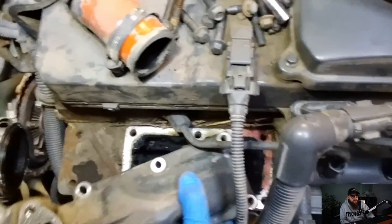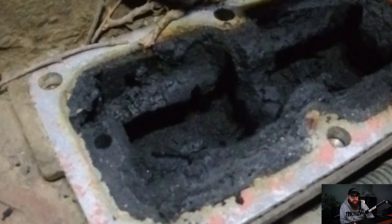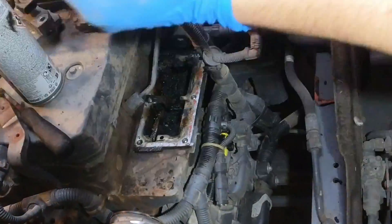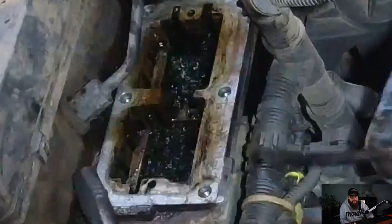As far as I'm concerned, we're going to have a good go at getting all this clean today. Out comes the EGR cleaner and a small scraper. I'm going to do my best to agitate this soot out of the inlet, and then use this shop vac to hoover the bits I've dug up out of the manifold.